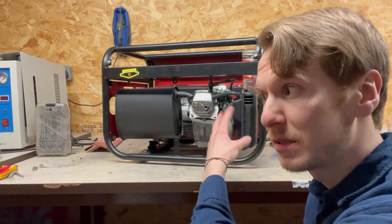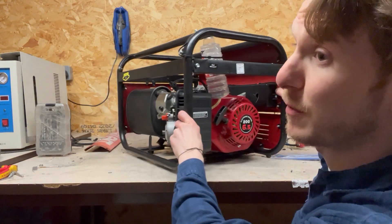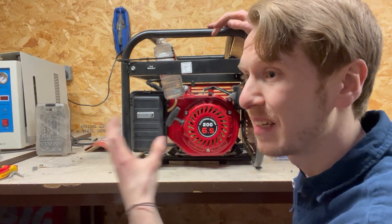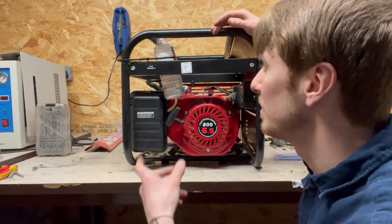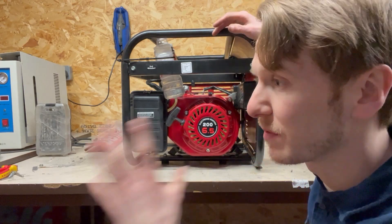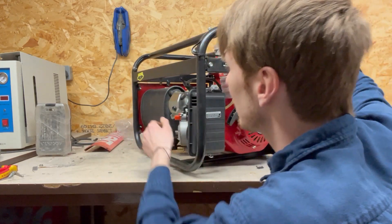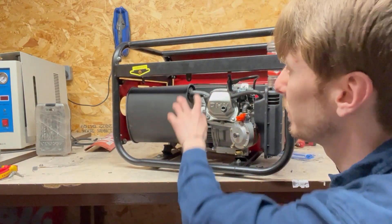The hydrogen carburetor has been tweaked again. I'm also running water as before — I've quickly fitted it and it's got a bit of water feeding into the carburetor, which is going to stop pre-ignition as I've mentioned in previous videos. It throws water into the intake, which is fantastic for cooling, though not great for rust — the exhaust on this engine has already started to rust, and we are getting some leaks around the flange.